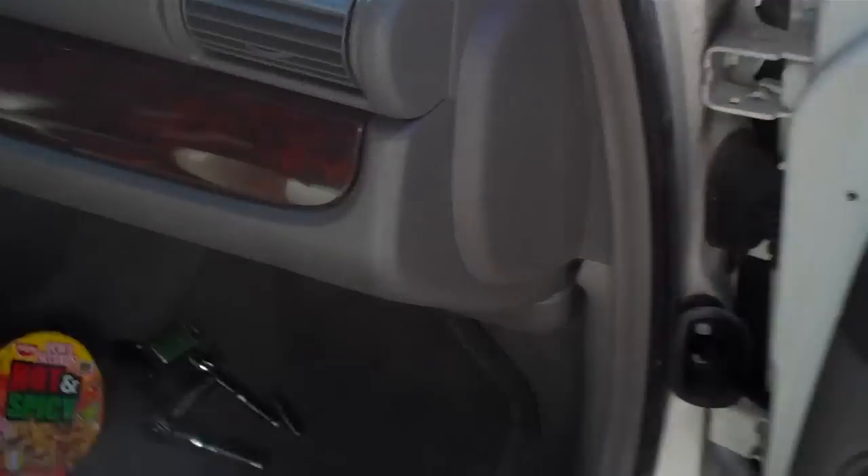So then you go around and look underneath. On this one — a Chrysler Sebring, an '02 — I had to pull down a cover held by a little nut in the center. I pulled the nut off and set it aside, and sure enough, here's a telltale sign of a blower motor: you can see a big electrical plug and two wires. And then you see this over here? This is the problem — this is why it only works on number four.